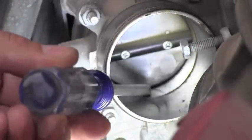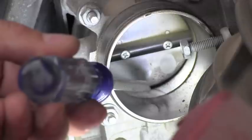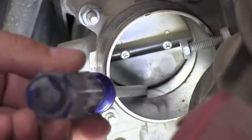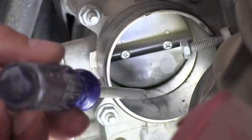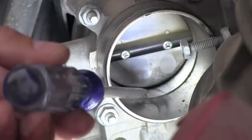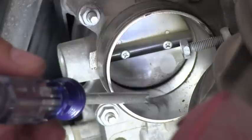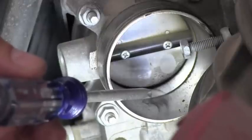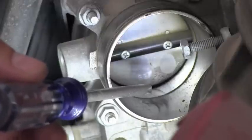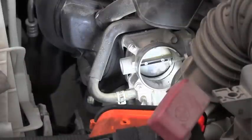The area on the bottom of the butterfly valve is being plugged by the dirt. There is a space which opens for air during idle conditions, and now this is being completely plugged. The computer has to make adjustments for idle to happen correctly.